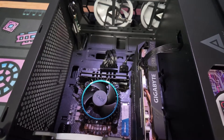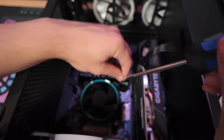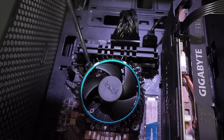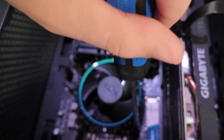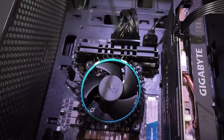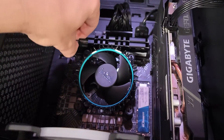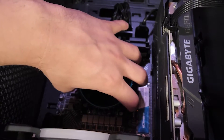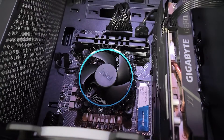Like I said, Intel CPU coolers are a little bit weird — they don't have regular screws. With the flathead you should be able to get it in between those grooves and turn them left. You should hear a click after you've done that. Remove the CPU plug, and before you take off the fan, make sure you wiggle it a little bit first because the paste is going to be kind of sticky, and if you just pull it straight out that CPU might come with you.